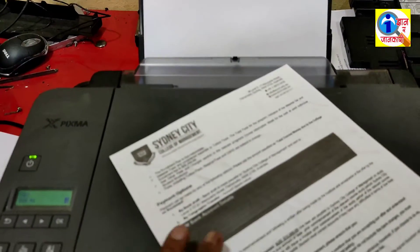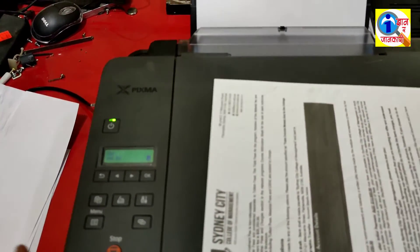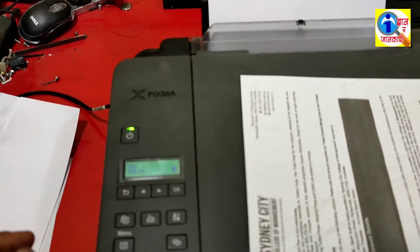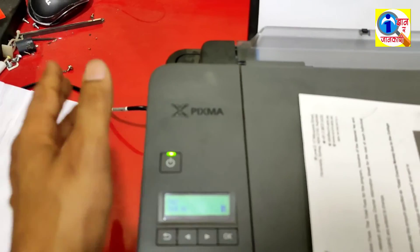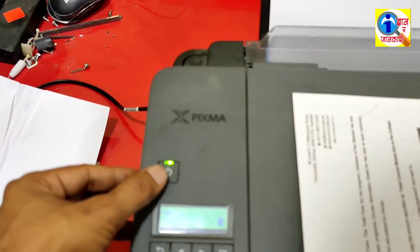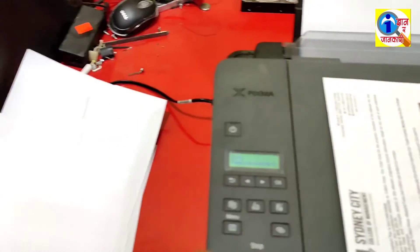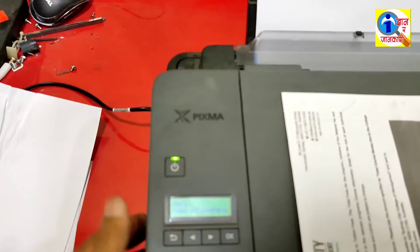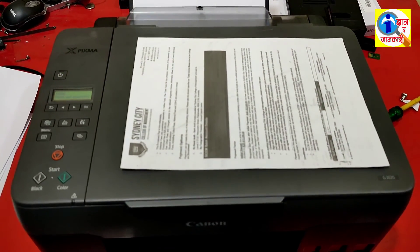The machine has copied successfully and our printer is ready to use. Mainly the problem occurs when you directly power off or directly unplug the power. So make sure before turning off the printer, you press the power button once, the machine will shut down properly, and only then unplug the power cable. Thanks for watching, please subscribe and keep updated. Bye bye.